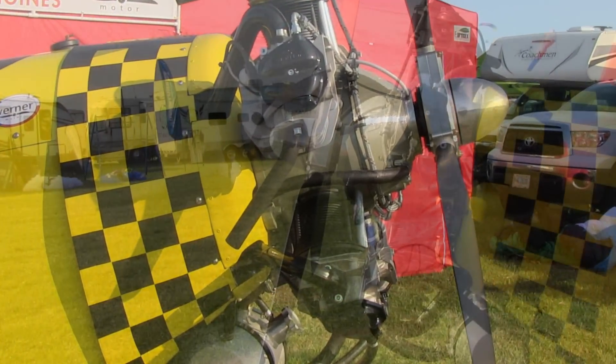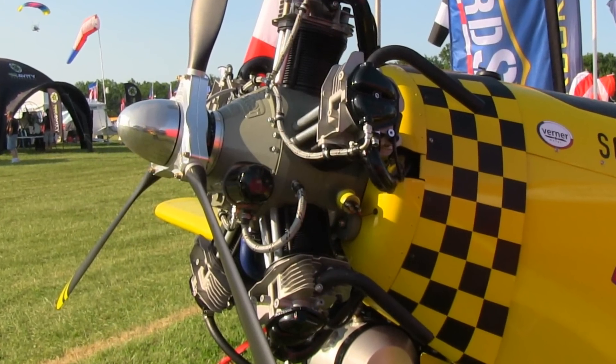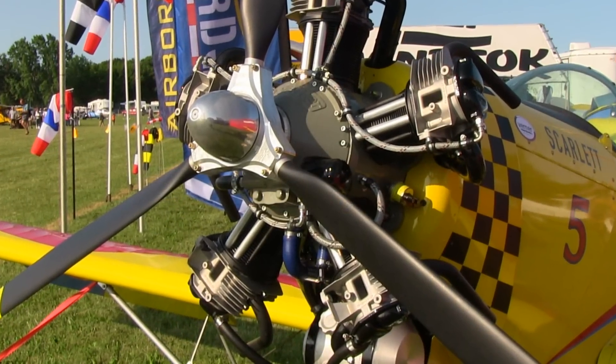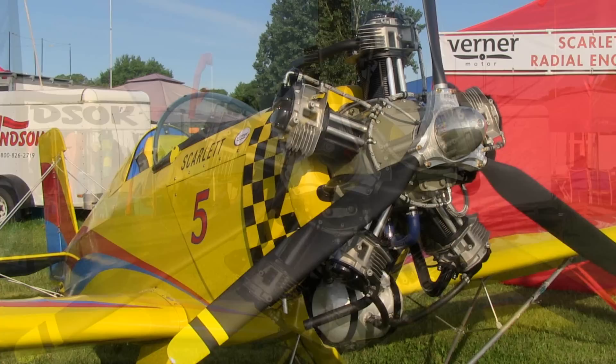From what the plans had, I put some steel gussets right on the longerons. They're triangulated gussets, they're probably six inches long, mild steel. So I just beefed it up as the motor mount. And that worked out great. Then the firewall was already sufficient because of the full VW engine that it had on it.